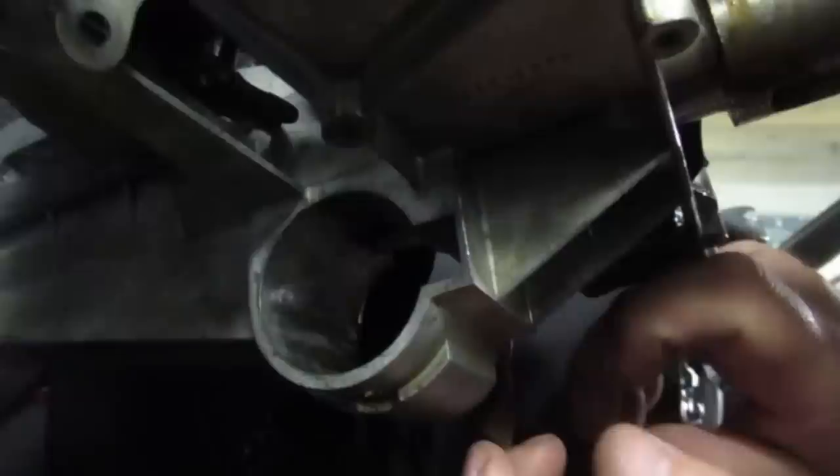So instead of just turning the key to the correct position and pulling the tumbler out as it's supposed to be, you have to actually take half the car apart. We got a grub screw which we thought we'd take. Removed it and it wouldn't go. That little thing that sticks out — even when fully retracted, it was getting caught. So all we could do was dismantle all this so we could push down on it from inside the column. The bearings all came out, and this all has to be reassembled and indexed because we don't want the steering to sit cockeyed. That is our goal for this afternoon.